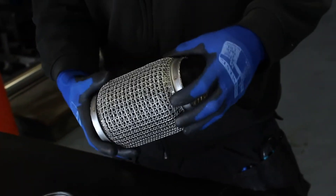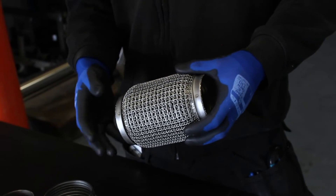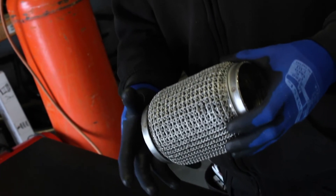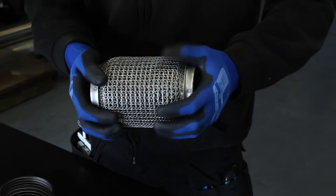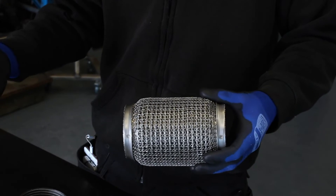These are perfect for downpipe applications. A lot of what you see on OEM cars from the factory is that the exhaust system is one whole piece — usually a cat section and then the exhaust system after that as one whole piece. So removing the downpipe in some instances means you have to remove the whole exhaust system first. If you fabricate a downpipe on that kind of vehicle, these soft flexes can make that process a lot easier. Because they're so flexible, you can compress them right up, bend them out of the way, and get the whole downpipe out without having to remove the exhaust system.